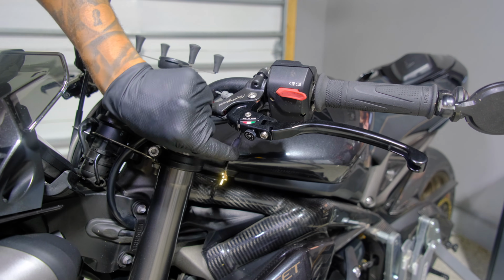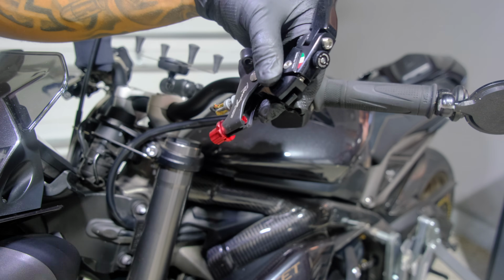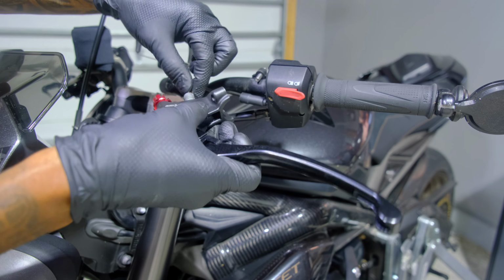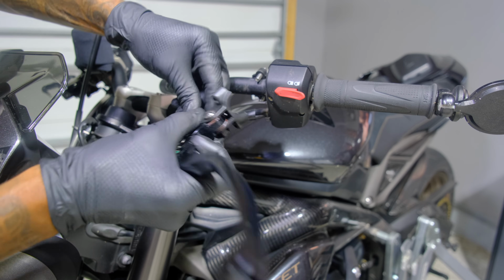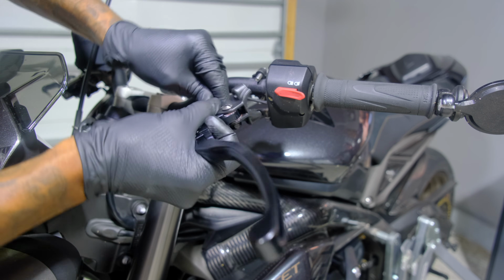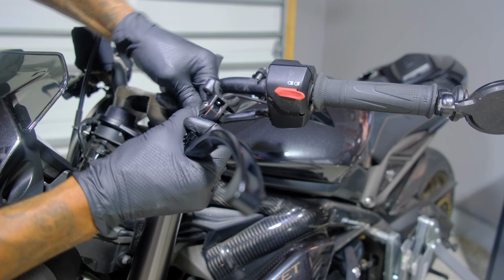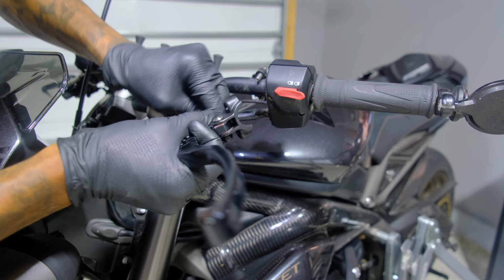So now I got the wire ends crimped up, so red and black. Alright, so finally got the terminals on the plug. Found it a little easier taking the clutch perch off because you don't have much space to play with, and sliding the terminals on. Then you just take this cover and push it up over this. Get it nice and snug. I'm still not trying to damage the terminals. You don't want them coming loose, and you don't want this switch backing out.